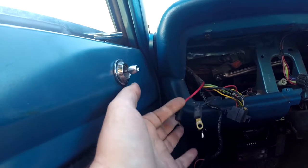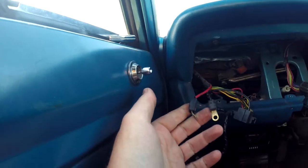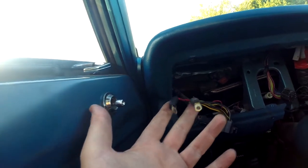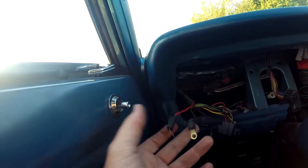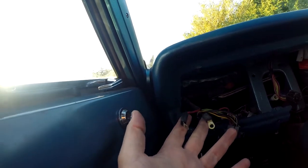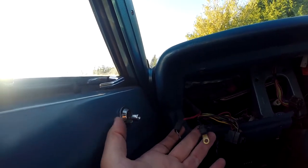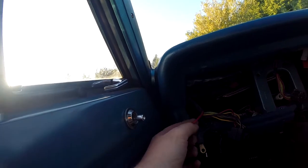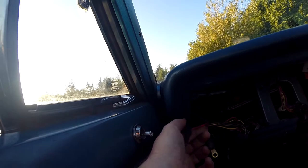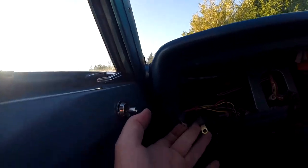These were the two wires I expected to be burnt out. This is where the same problem I had on the '64 Chrysler was - it's exactly the same design. These are super hot wires that come from the back of the alternator, so at some point or other they carry all the juice the alternator can put out, which is a little much for wires of this size. These may be one gauge better than what was in the old Chrysler, but I expected these to be burnt out.